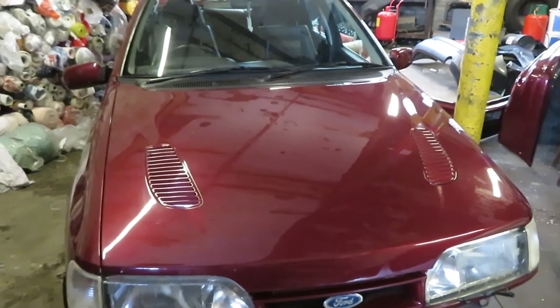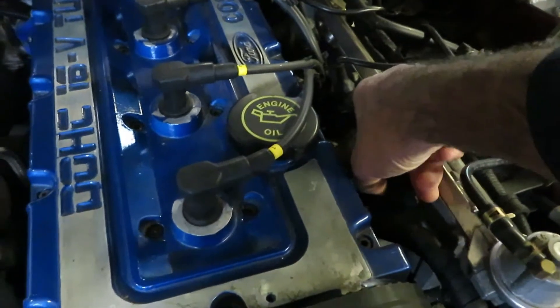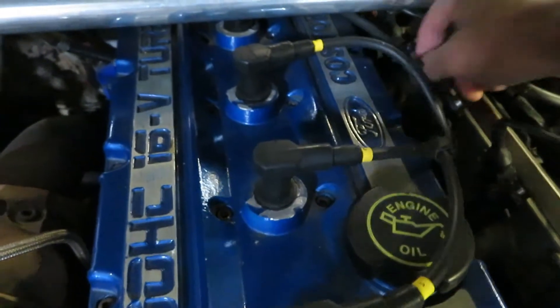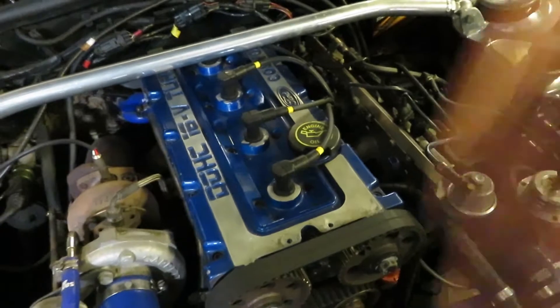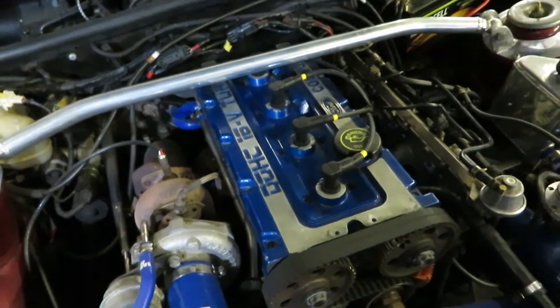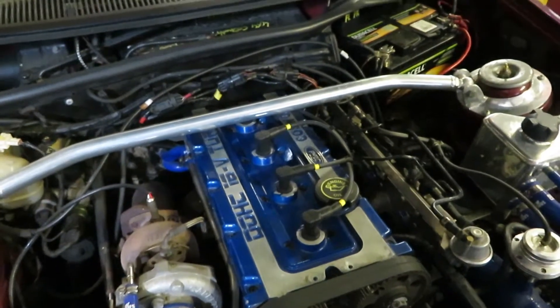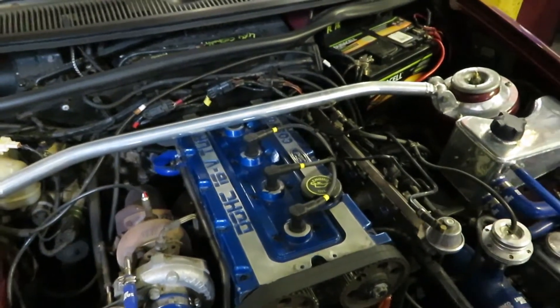So I'm just going to go through a couple of bits to show you how I'm going to try and get this thing going. First thing I'm going to do, now we've got the battery back on the vehicle, is disconnect these injector plugs here. The reason I'm doing that is because this engine has been standing so long — I don't want to start it up absolutely dry on oil, because all the oil will have run away from the camshaft, hydraulic lifters, and everything like that. Some people pull the HT leads off the spark plugs — I don't advise that, because whilst the injectors are connected they're going to still be spraying fuel in there and washing any lubrication off the bores. So this is the way I do it.